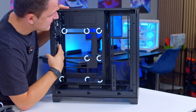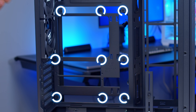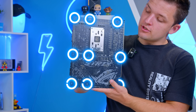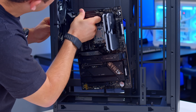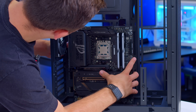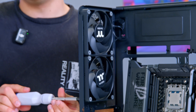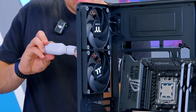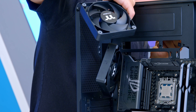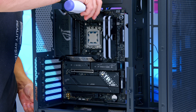I'm next going to take a look inside the case at all the standoffs. In this particular chassis, all of the standoffs are in the right locations for ATX motherboards — there's three at the top, three along the middle, and three down the bottom. They actually match up perfectly with the screw hole locations on the motherboard itself, and as long as these two match, you're going to be A-OK. I'm then going to slide the motherboard into the case. The center standoff is raised, so that should hold the board in for us, although it's a bit of a tight squeeze with the rear fans. The fans are going to be changed anyway, so it makes sense to take those out at this point. When you're PC building, a lot of it is just about adapting — sometimes doing things in a slightly different order can be helpful. Once you get one or two screws in, it starts to stabilize and makes installing the remaining nine screws that little bit easier.